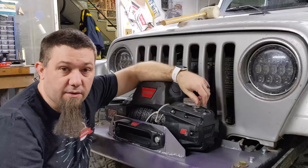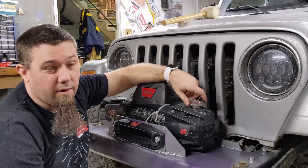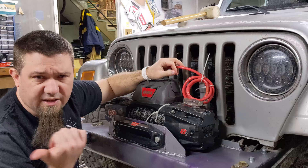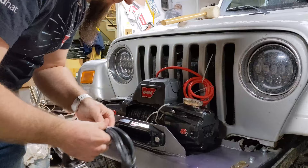As you can see, the bumper is mounted and so is the winch — nice and solid. Now I've got to wire it. Wiring is pretty simple. There's a positive cable on the back of it, and for whatever reason the negative cable is detached and in the box. There's a stud on the back I have to attach the negative cable to, and then they both get run up to the battery.